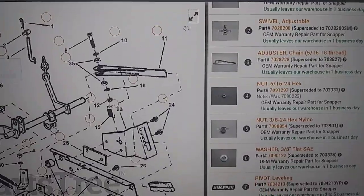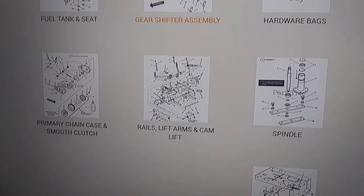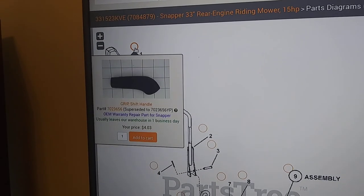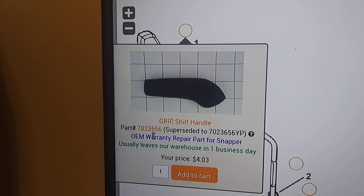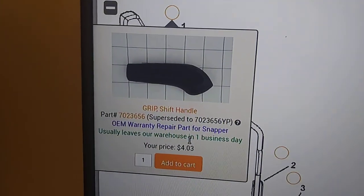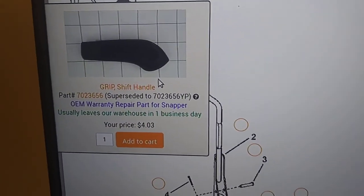People are wanting part numbers, so let's go with something obvious — there's your gear shifter assembly. What's the part number of that gear shift knob? In Parts Tree, see the little circle — I can click on the circle and that shows me right here: it's four dollars and three cents. That's the original part number, that's the superseded part number, and it's four dollars and three cents and in stock. On newer mowers you can find just about any part you want, although it will probably be superseded — it's usually the same thing. Briggs and Stratton bought out Snapper.